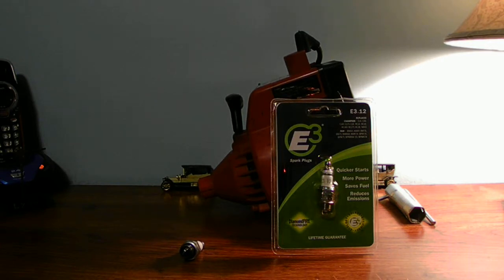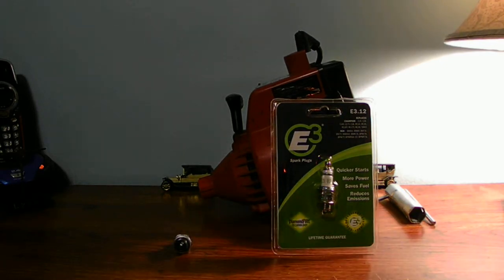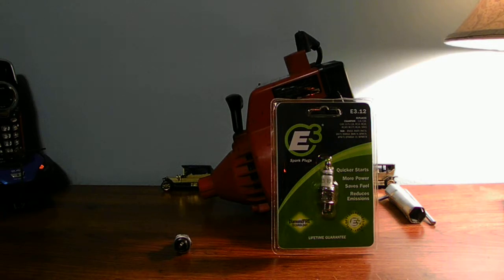The reason why you'll be replacing your standard spark plug is because maybe you want more power or more performance in your machine. These spark plugs do last a long time — up to a thousand hours, I think. But you might want to change them or clean them once a month when the season comes again, to have easy starting.